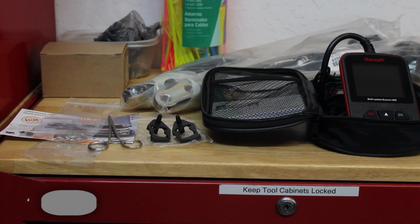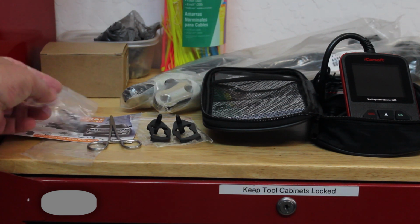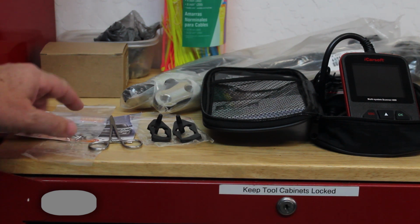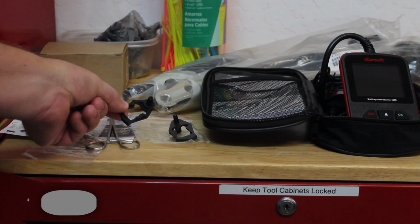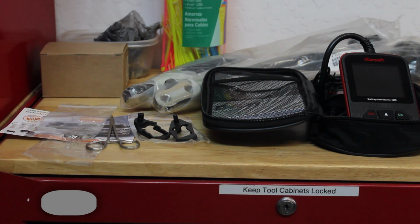So in preparation for opening up the door panel and trying to repair it, I have bought some of these springs, some UCAR accessories, in case it's one of the springs. These cause machine gunning when they break. And on eBay I also purchased some of these parts here. There's one for the left door and one for the right door. These sometimes break, these little cam systems. So I'll be taking the whole thing apart and seeing what I can do to fix it.